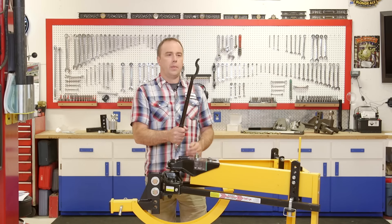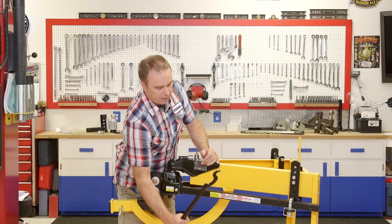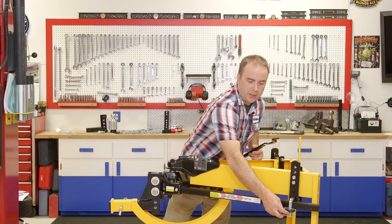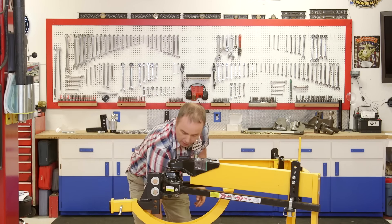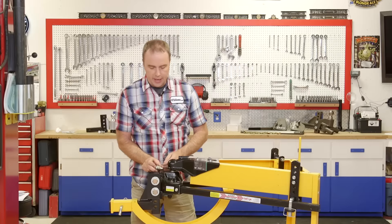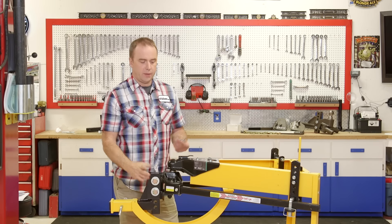It comes with a snap-up lever. When you connect your coupler to your trailer hitch, the spring bars are in the down position. You grab the bar with the snap-up lever, push it inside the hole, and pull it up into the active configuration. Once in place, you put a pin in and a capture that keeps it from moving around. To adjust the actual weight distribution, it comes with washers and a pin configuration that goes inside the head. As you experiment with your setup, you add and subtract washers until you get a nice level configuration, then lock the bolts into place and you're good to go.